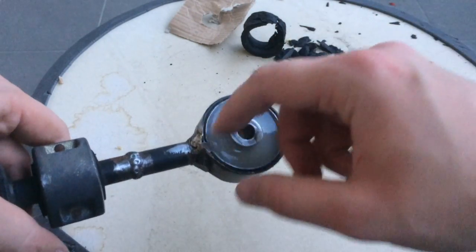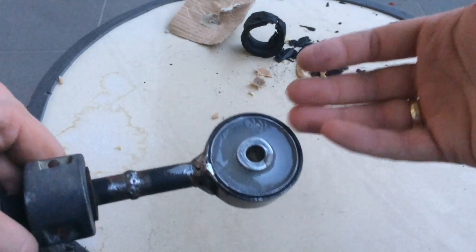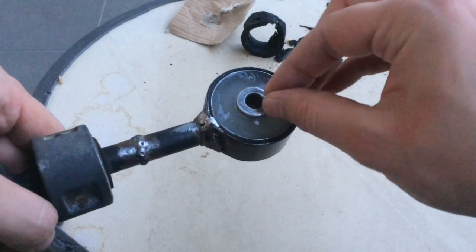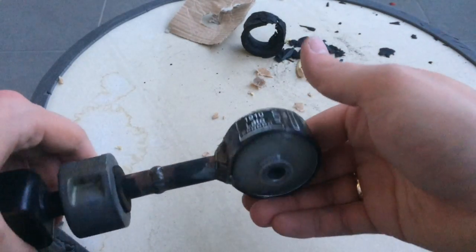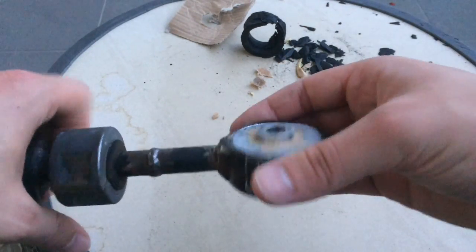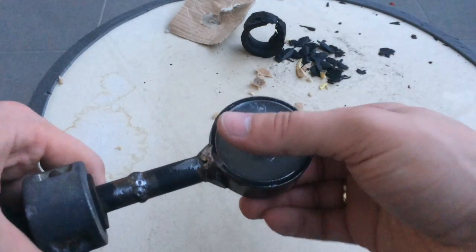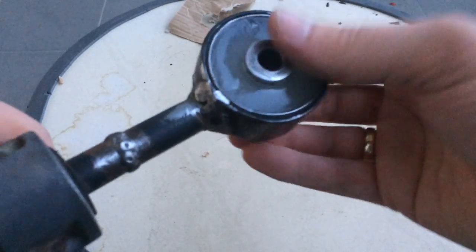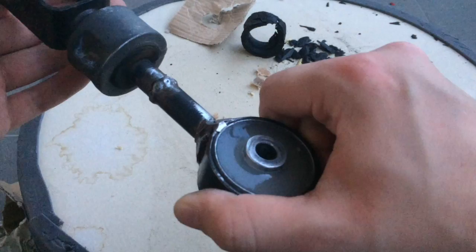I might need to make it thinner to make it more flexible. Lesson number one: you need to pay more attention to air bubbles. I didn't pay much attention when I made this bushing and the result is that there are air bubbles trapped there, especially on this side. I'm not sure how it will affect the quality of the end product, but this is why I'm doing this — to see it and to learn. I don't know if I can put it in the car already, but I will and I will see how well it performs.